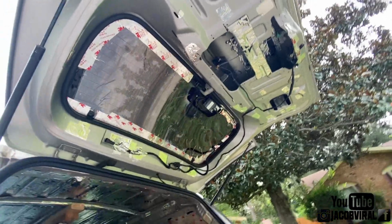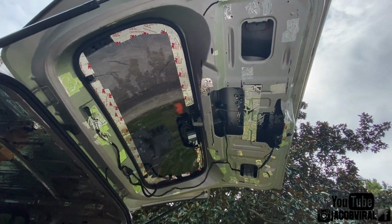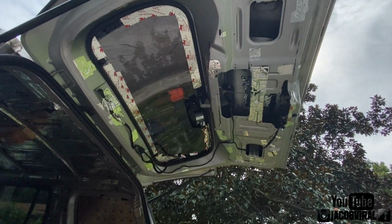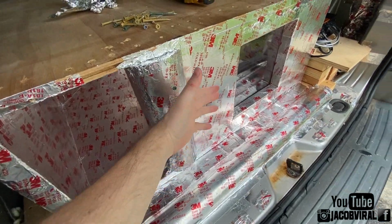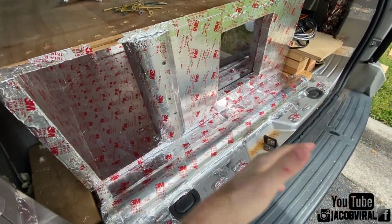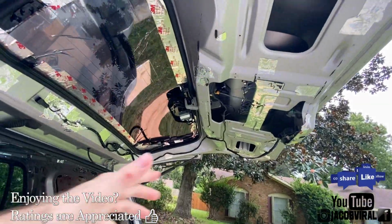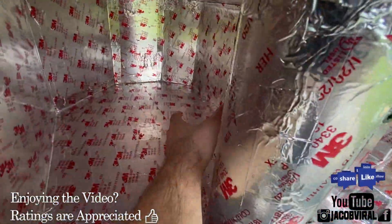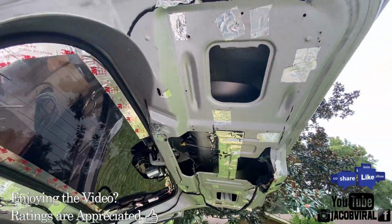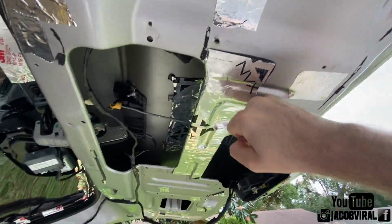And this is probably one of the most important topics to know when it comes to audio for no-wall builds and trunk builds: where is your bass output coming from your box, especially the port area? Where is the bass reflecting off of? With this open, it still gives you output in the vehicle, but there's not a wall point where your system is reflecting off of, like bouncing off of the sound waves.